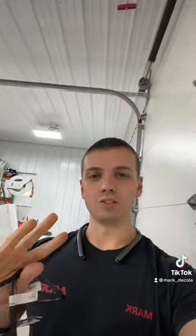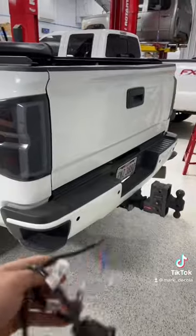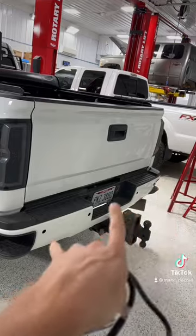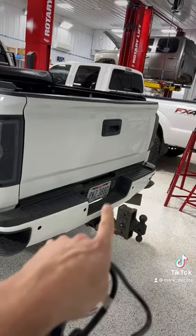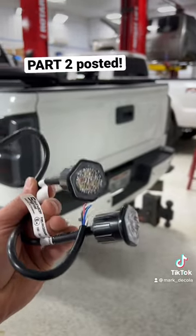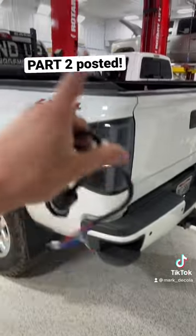Once the power is hit, these lights will start strobing in a pattern of orange. We're going to run these and program them in groups so that it'll go group one, group two, group one, group two — meaning those will kind of wag back and forth in two different flash patterns but be synchronized all together. Once the truck is thrown in reverse, the white will activate because we will have them tied into the factory reverse.